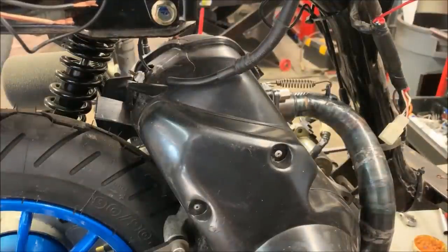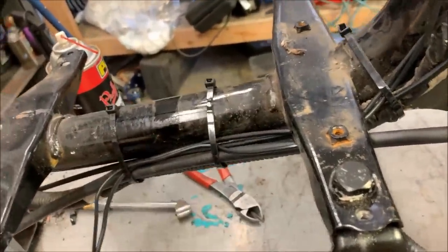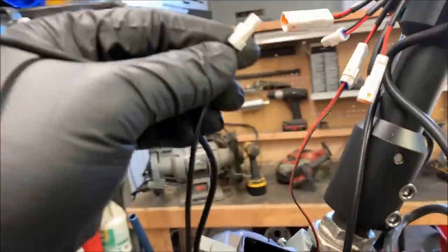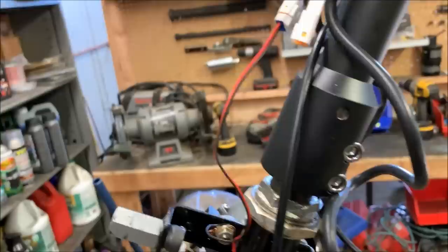That's all you have to do at the back of the motor. Run along the frame and underneath the floorboard, making sure you don't put wires somewhere they'll get pinched. Run along the stock wiring harness or brake cable. Run everything all the way to the top — the connectors are designed so they can't plug into the wrong spot. Plug the single red wire into the single red wire for RPM, and the wider two-pin connector is for cylinder head temp.